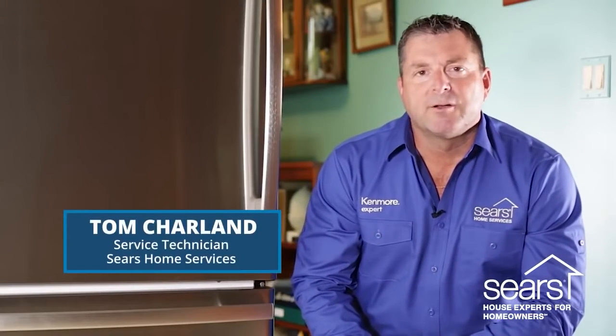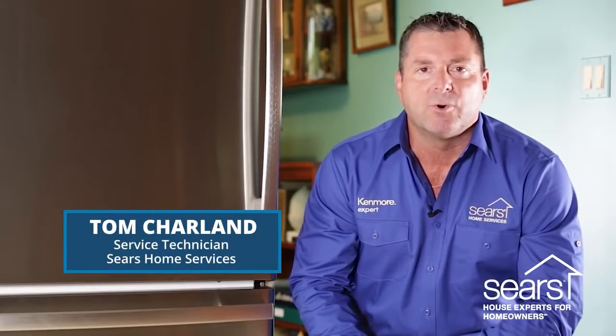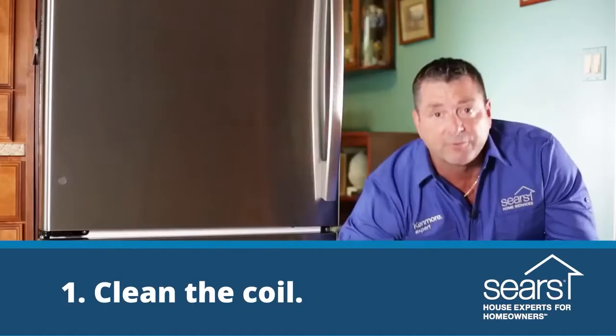A contributing factor to poor refrigeration temperature is usually a bad or dirty condenser coil. Most condenser coils are located under the front of a refrigerator, on the bottom of the floor. The condenser coil can be accessed by removing the grill from the front of the refrigerator